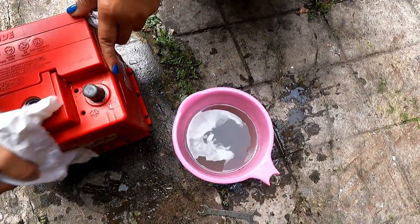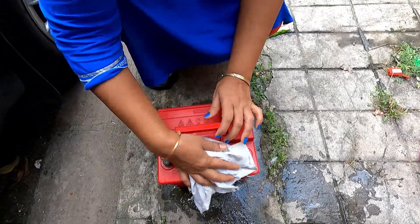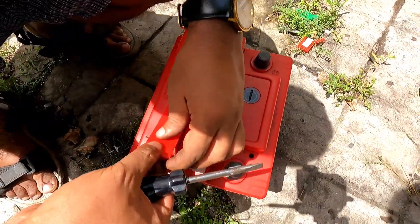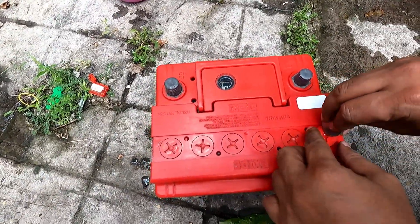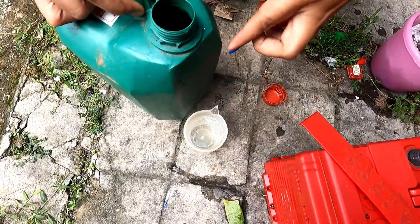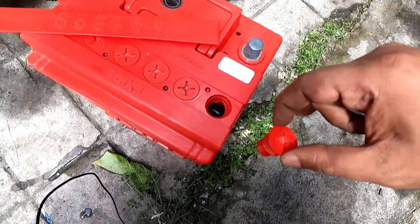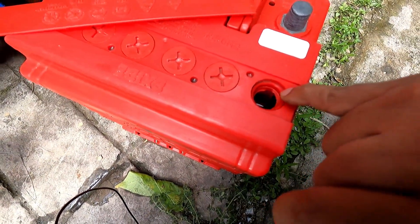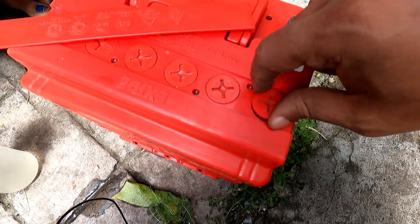Now I will clean and dry the battery. We will also check whether any distilled water topping is required or not — I will show you how to do that. I have opened the distilled water compartment. Open each cell and check the electrolyte level. Yes, it requires some distilled water. The water level should just touch that red stick, so never add water more than that level or it will overflow and cause more leakages.